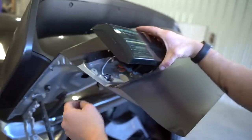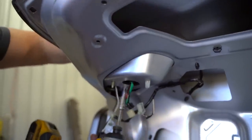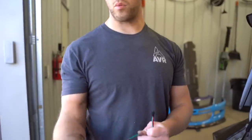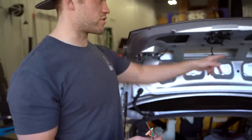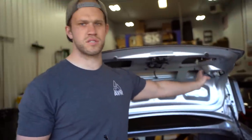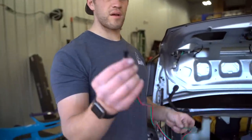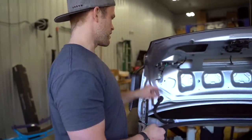Oh, looks so much better. Okay, so we got this taillight on. How this little wiring harness works, the wire with the resistor will run from one of these plugins over to the other side taillight that goes on the trunk, so the inner taillight. And then the one without the resistor runs from right here and then in through the trunk.